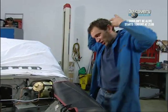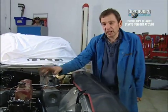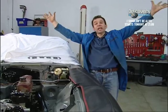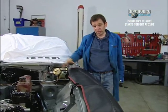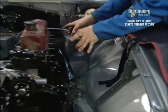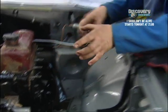Doesn't the engine bay look so fantastic when you start to add a few bits to the engine? It's really coming on. Obviously, we've left the old rocker cover on because the last bit to go on there will be the new rocker cover, and the whole thing will go ka-ching with glory when it's finished. But there's a lot of work to be done before then, and as you can see, there's a big hole down here. Now, obviously, there'll be carburettors here, but underneath those, first thing to go on are the manifolds, inlet and exhaust.